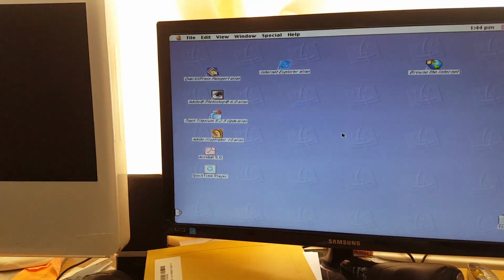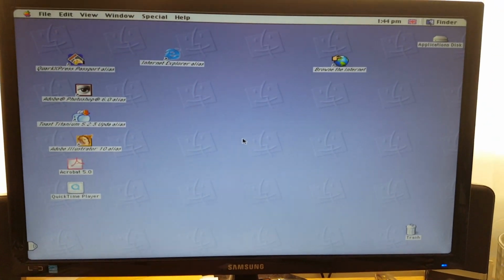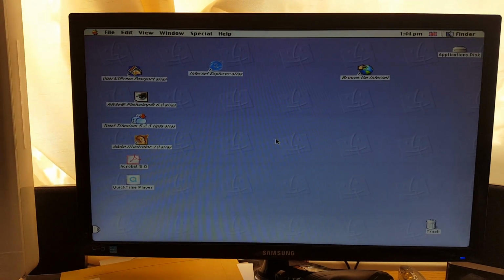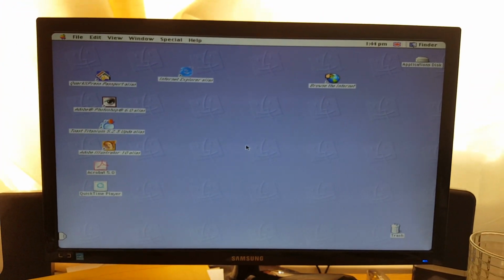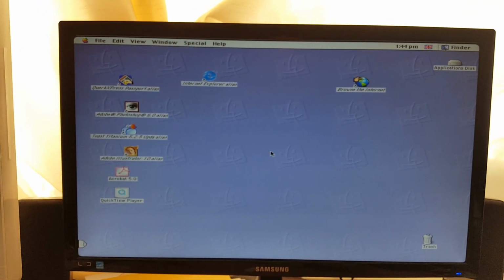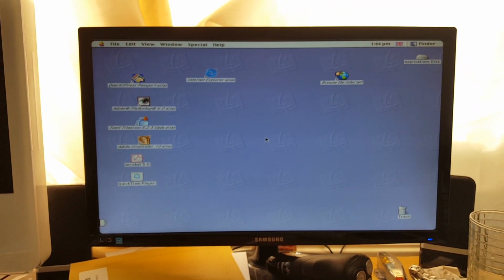Okay, well, what I think we'll do is I'm going to take the hard drive out again. I'm going to put the two 120GB hard drives in, and we are going to run the Mac OS 9 install disk and play around with that system for a little bit. So stay tuned. Okay, so I've removed the hard drive again. Just about to open these two up, and I just realised I don't have enough screws to mount both of them at the moment, so we'll unbox one of these and put that in there for now, and I will have to go shopping for some screws.